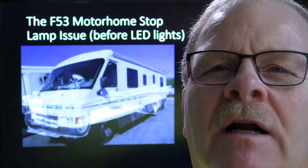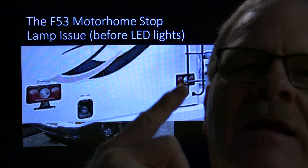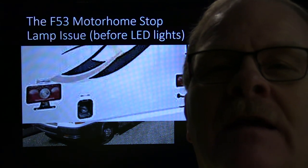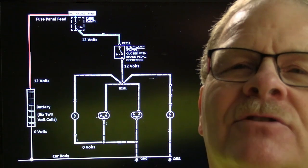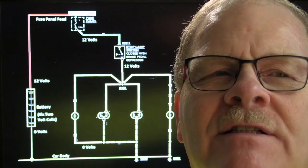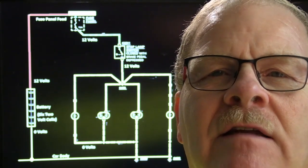This was a different problem they were having — the stoplights had stopped working. These motorhomes had four big lights on the back that would double as tail lights, turn signals, and stoplights. If you put stoplights on there and you've got a little plastic stoplight switch that's not made to carry all that many amps, and you load it up with four two-and-a-half-amp stoplights, a switch that might be good for five to seven amps — if they sit in traffic a lot with their foot on the brake, it eventually burns up that little plastic switch.